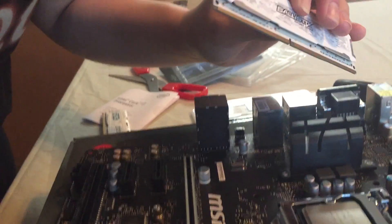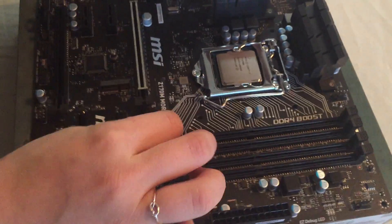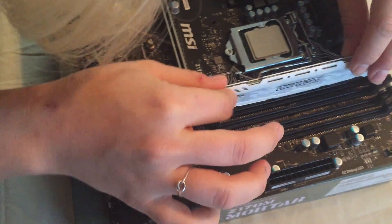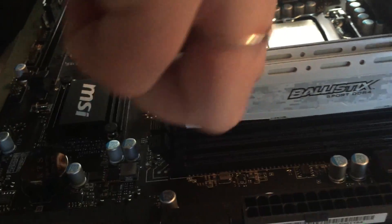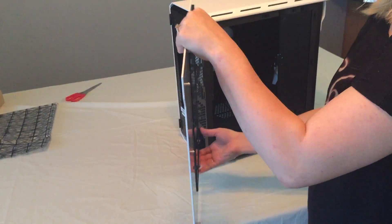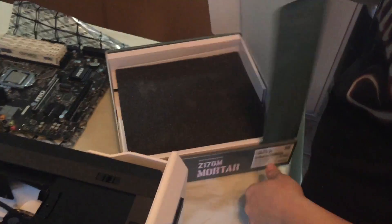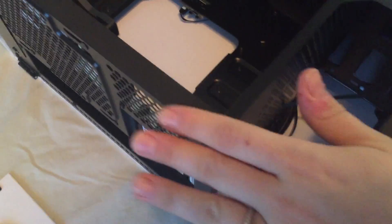This portion of the motherboard is pretty much done. Push the case down onto its back. Inside you're going to find the I/O shield — go inside the case and have that pointing out, sticking out right through this space. Now you'll see inside there are a bunch of what are called standoffs — these little raised screws. Set the motherboard right on there but turn it 90 degrees, then drop it in and it'll be easier to line up the holes with the I/O shield.